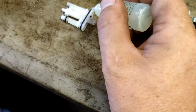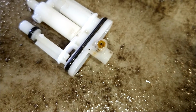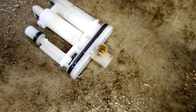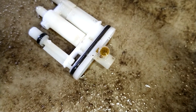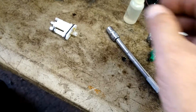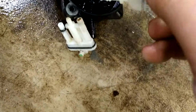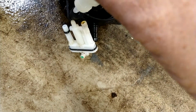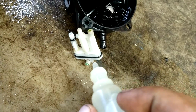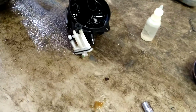So you'll be alright. Alright guys, put a couple drops right in that jet right there. There's one. Look at that bugger go already. Boom. One drop of acid did that. One more. Good. Pumping. And we're going to set this up right. And we're going to get a drop in this side right here. And right here if we can. This one and this one, those two. And we're just going to let that sit there and fizz.